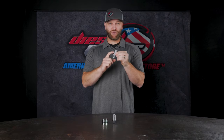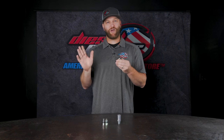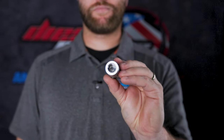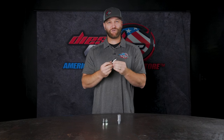That means there's a spring and a check ball in here, and when it overcomes a certain amount of pressure, it'll start bleeding that fuel off and return it back. Now, this race plug — or pressure relief block-off from PPE — as you can see down the middle, I don't quite see as much going on there, but if I turn it around, you can see there's no hole. There's nowhere for the pressure to bleed off. There's no check ball, there's nothing in there, so any pressure that the rail was making is going to stay there.